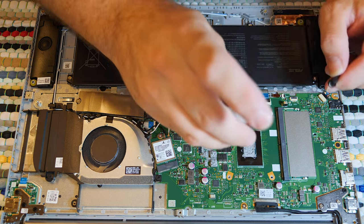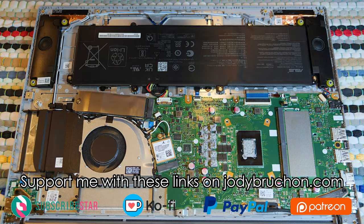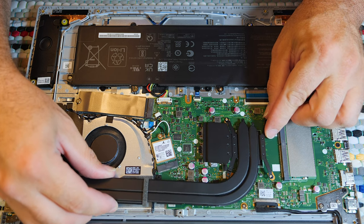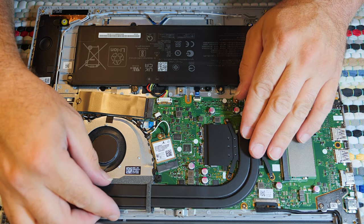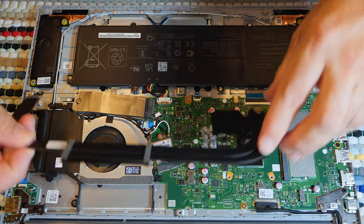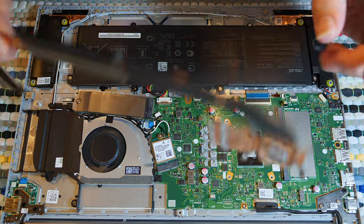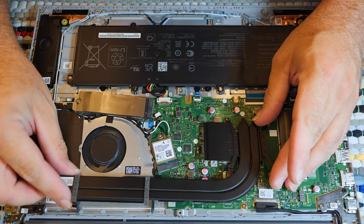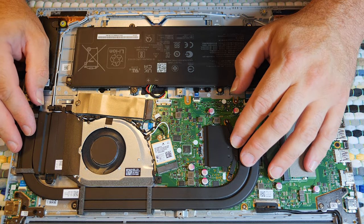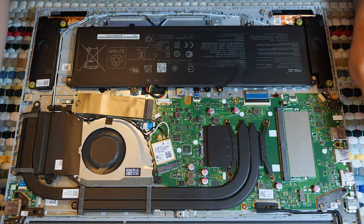So there appears to have been at least some reason that they just sort of splatted on the heatsink paste in that corner. Let's go ahead and put it back down again. See what kind of coverage we get again. Real quick, gentle push and pop. And it looks like, yep, everything's making contact, so if we screw it down, it should be good to go. And I should actually get several years out of this if everything holds up. All right, let's start putting screws back.